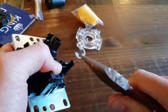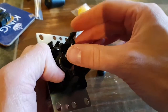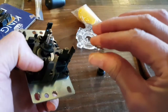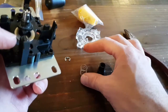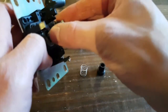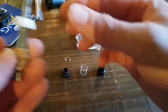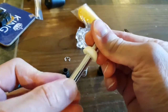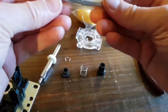There we go. The way the shaft is held in is basically by this little semi-circle clip here. This allows you to push the shaft down with the spring so you can access that little clip to pull it out. The best kind of tool is a nice thin pair of pliers that you can grab that bit of metal and just take it off. Get a grip, pull it off. There we go! Now that should come off and then the spring comes off. These are the springs you can change to get a firmer spring. That's the standard spring that comes with the JLF, and then there's another bit of plastic. Now the shaft is going to simply come out.